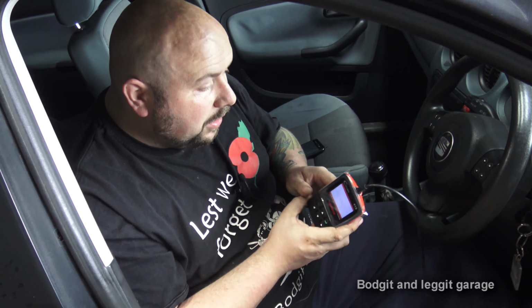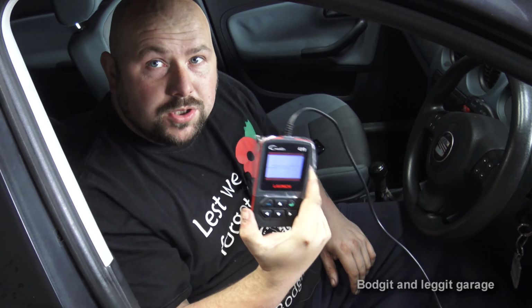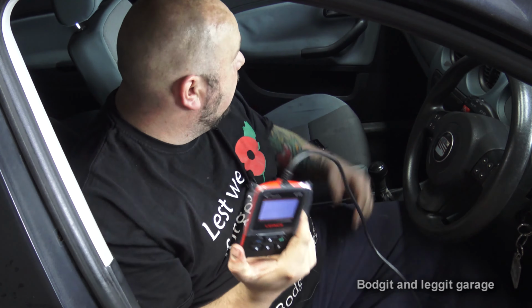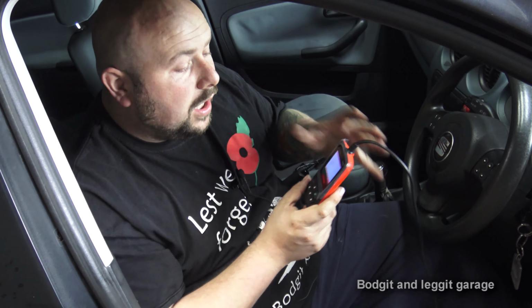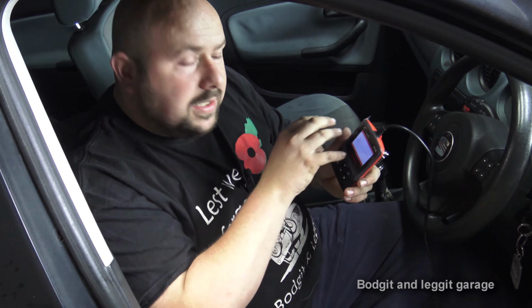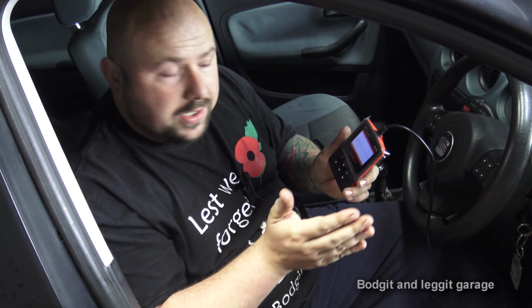That's it really. It's one of them things you can buy. Anyone can buy one. It'll work on most OBD2 cars. And you can leave it in your glove box if you want to mess around with a few cars. What I suggest you do, and I said it on my other video, is you get the information off this when your car is running properly. Take the intake temperature, the pressure, the turbo pressure, whatever car you happen to have, take all the readings from it. So if you do have a problem, you can match your good readings to your bad readings.